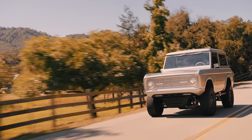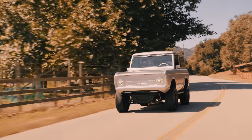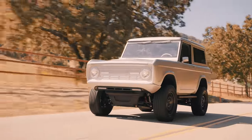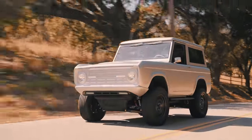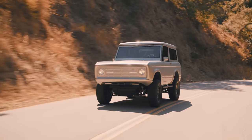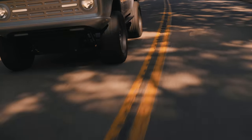They're big, tall, off-center cars, so you have to take into account your center of gravity and your roll center. What we did to fix all that is make the battery directly in the center — so it's low center of gravity, in between the two motors, which is really where you want any EV to be. Out of the box it is 600 horsepower, but what we found from our clients driving is that was pretty terrifying — it was like a rocket on a jet ski, just too much power for its base. So we dialed it back and played with it a lot to get it really comfortable. Now it's more like a confident yacht where it lets you know it can go fast, but it doesn't keep jerking ahead.